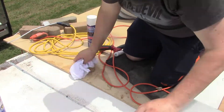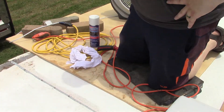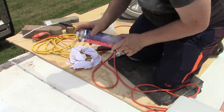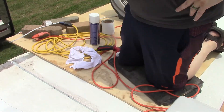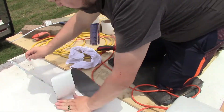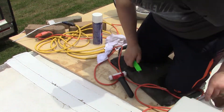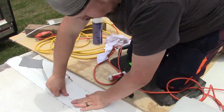After finally getting all that fixed, we're ready to fix the cut I made in the rubber of the roof. For that we're going to use our dear friend Eternabond tape — that's like the Frank's Red Hot Sauce of roofing, you put it on everything. They make a special primer and cleaner, so I used it, though a lot of people don't. The main thing is to get it as clean as you can and apply a lot of pressure when you put it down — use some type of roller for best results. I went ahead and overlapped another strip of Eternabond on there too, because I was afraid just one strip wasn't going to be sufficient, and I wanted to keep as much water away from that area as possible.